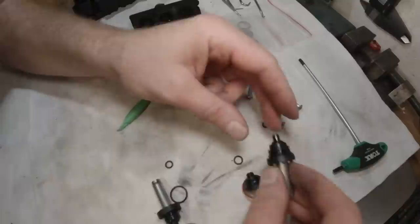I got these all back in, put the connector back on, and snap this back in here. Look at that — didn't lose the tie wrap yet and haven't had a fault all week. After venting the air out of the system using the GAP tool, I also have to re-enable the electronic air suspension — I had to push that button. Before that I had a fault. It went up here — I thought the car was going to tip over.